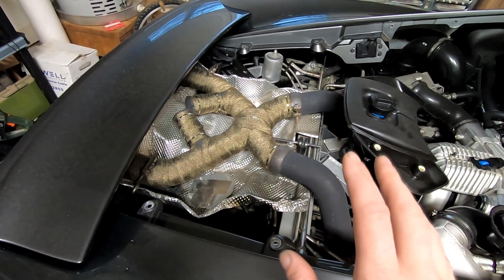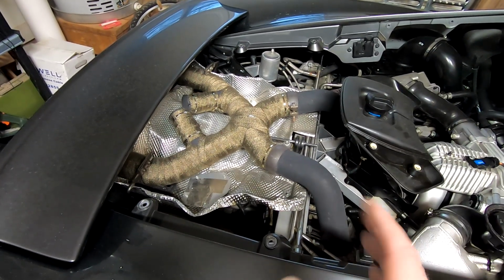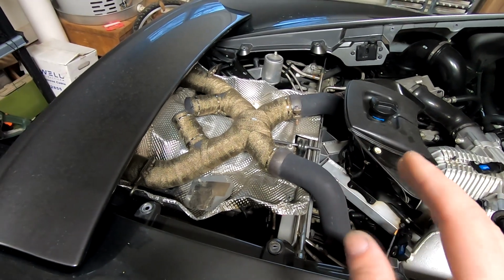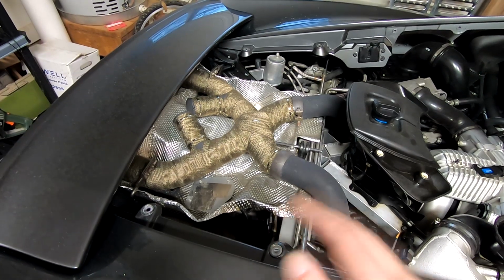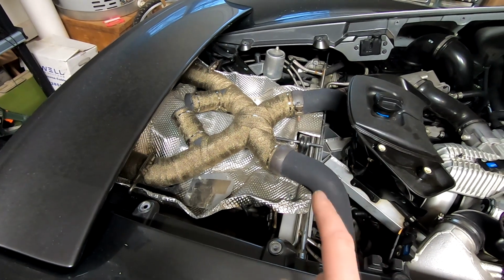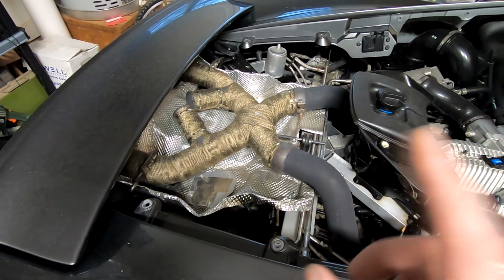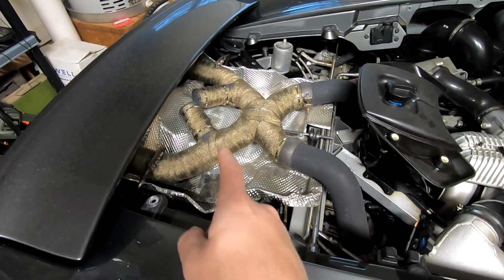I think where I'm hearing it now, a little bit at like 3,500 RPM, it's a lower tone, as it should be. But I believe that is because it brought the 3,800, 3,900 RPM down so far. Now it's just more apparent where it's shifted to. It's not as loud though. So I think after I do some highway driving, really get the exhaust nice and hot, it's going to be completely alleviated by having those branch resonators in there.